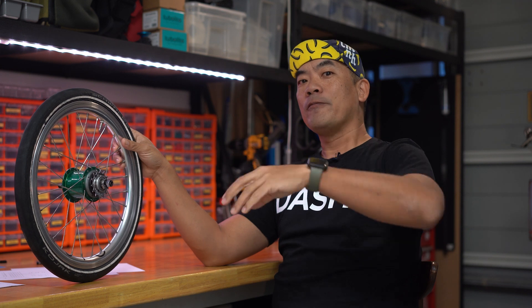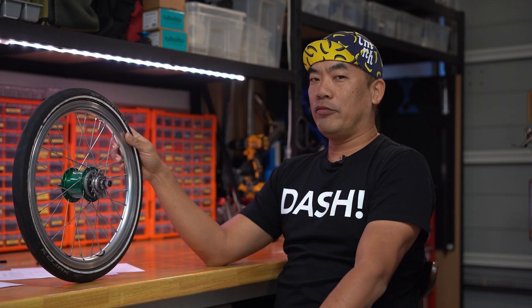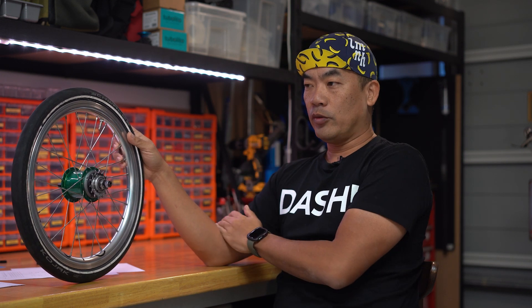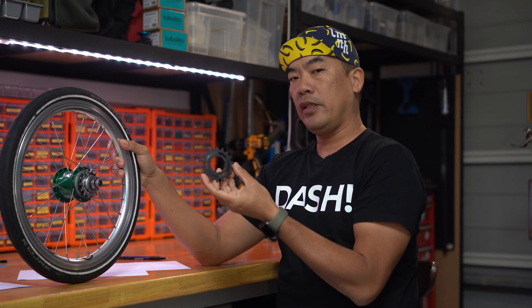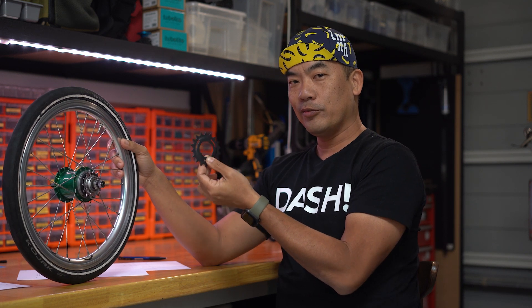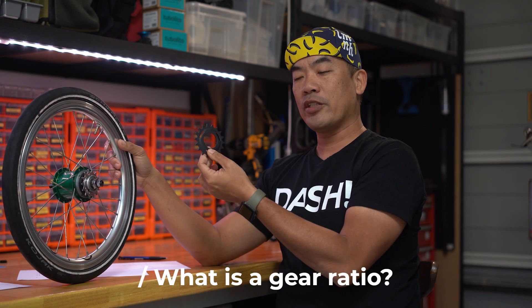How do we achieve that? I could, like every other Brompton rider, switch from a 50T to a 44T chainring, but I'd like to keep my 50T for now. I already know what size chainring I need — a 42T would perfectly fit my current fitness — but 42 is an odd size and I've already asked a factory to custom make one. Before it arrives, I still want to keep riding. So the other day while working on another vlog, I picked up this 18T rear sprocket. Working through the gear ratio calculations, it turns out the 18T would work quite fine with my 50T chainring up front.